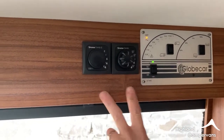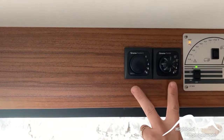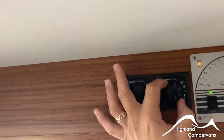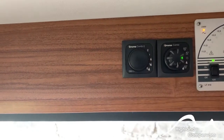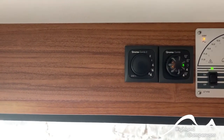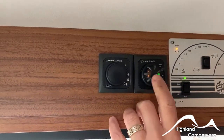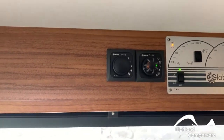For the room heating and water heating system, having purged the water through to ensure continuity of supply, you've got two dials here. The one on the right is for the task you want to do and the one on the left is for the source. Turn the right-hand dial anti-clockwise to either a 40 or 60 degree position — you'll see a green light come on and it will heat the water to 40 or 60 degrees. Whilst it's doing that you'll see an amber light come on; if that amber light is extinguished then it's achieved that temperature. It can take between 25 to 40 minutes depending on the output setting. If it fails, you'll see a flickering or red light indicating a problem or fault — turn the system off, check your gas supply, check your mains supply and then start again.